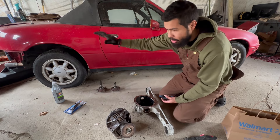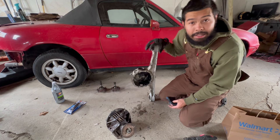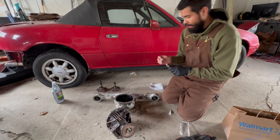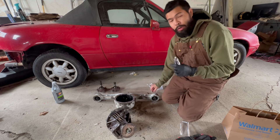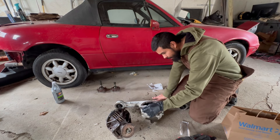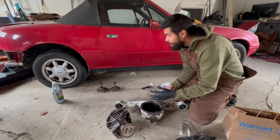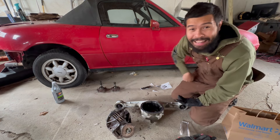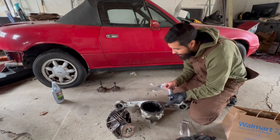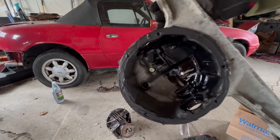That surface — minus not actually having brake cleaner — looks okay. I never know how much gasket maker to put on. I've done this plenty of times and still to this day don't know the perfect ratio of Ultra Black gasket maker, so let's just do a nice little bead all the way around. We're going for the world's cheapest JDM drift build. The question is should I put a little bit more on the bottom? Yeah, because this area right here is where it's gonna leak if it does leak.